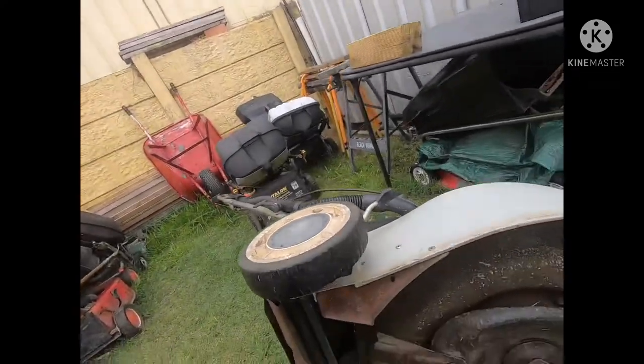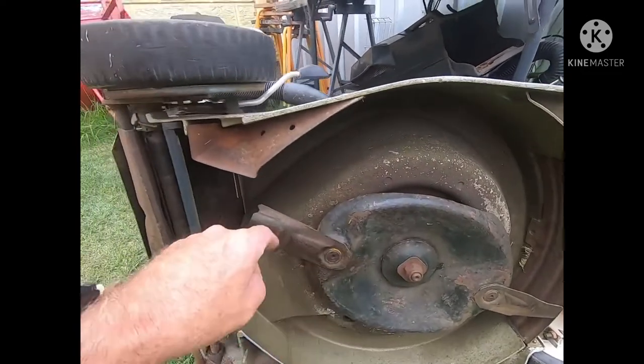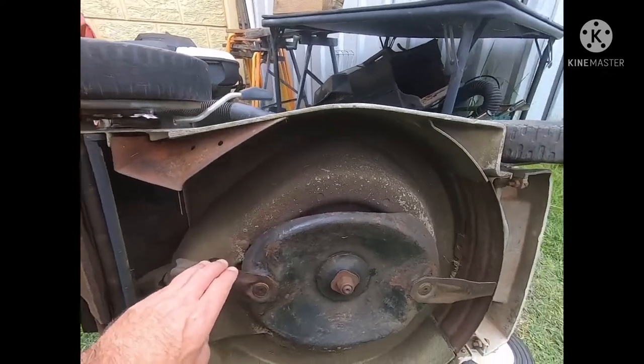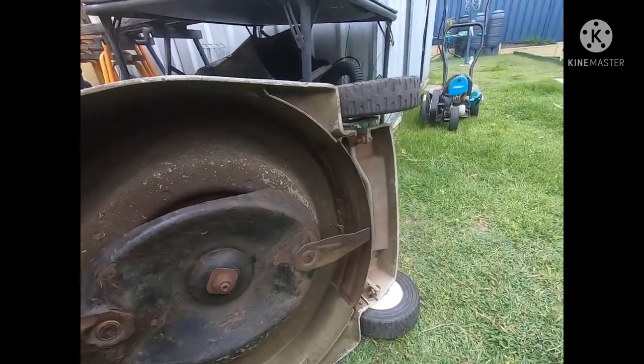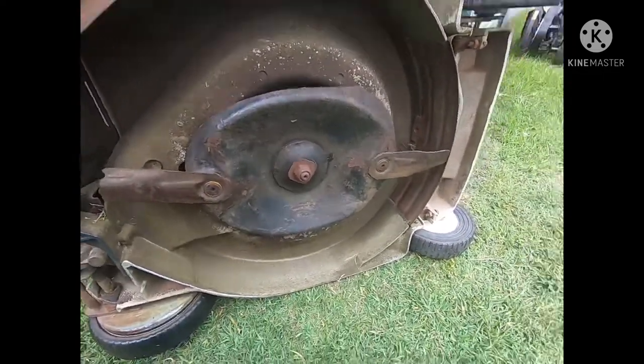I'm going to do some inspections. It's very hard to see underneath the mower at the pulley, so I'll tip it over. As you can see I can't see the pulley, so I'll have to take this off and have a look. The blades will need to be renewed — that's easy to get, you can still get them. The deck is fairly clean, pretty clean, but she'll be fine.